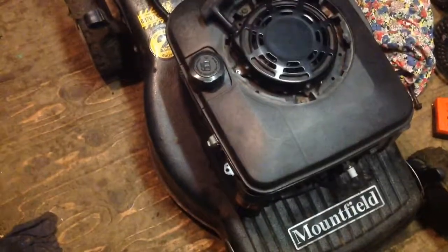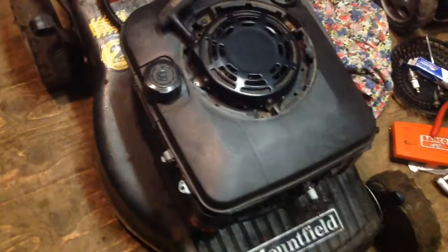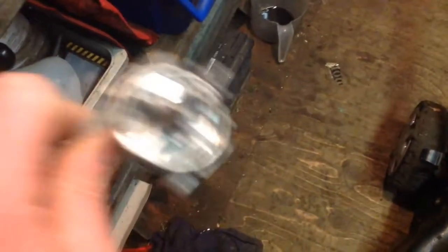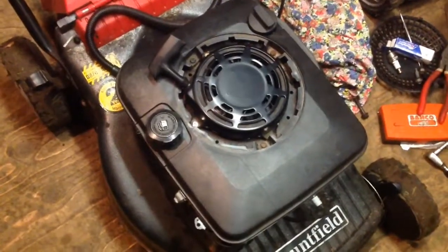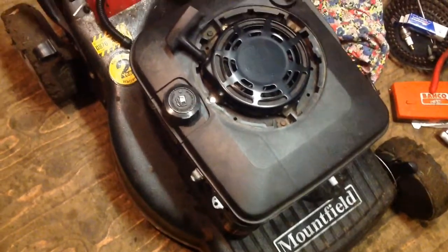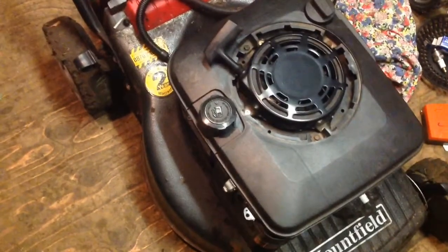I changed the coil and the mower still had the same problem, so I'm putting it down to two faulty carbs. This one here looks really clean but it doesn't run right with it on. And the other one has got a different problem — it starts and you can hear it running quite evenly at first and then it just stops. I cleaned it out for a second time and that doesn't seem to make any difference either, so I think I'm going to have to get another carb to see if that solves the problem.